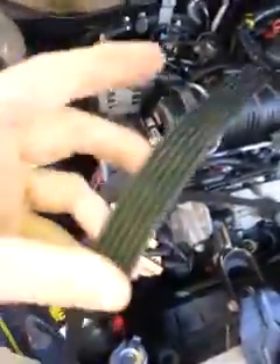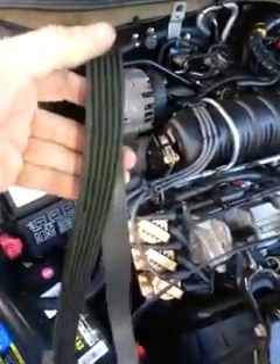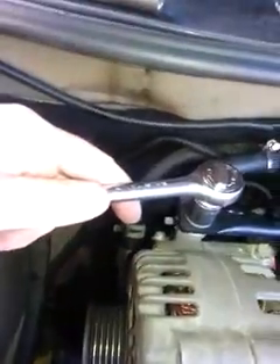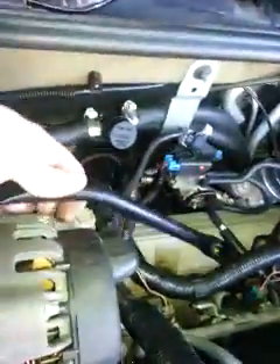The belt needs changing — if you look close there are lots of little cracks. It was $19 at the local auto parts store, so why not do it. Taking off that support arm next — it's 15 millimeter and takes some wrenching. Note: the lower bolt is actually 10 millimeters, so you'll have to switch sockets. There's your support arm off.